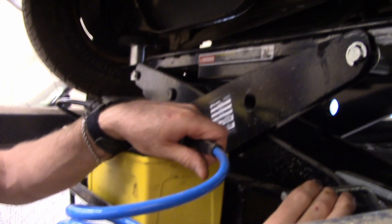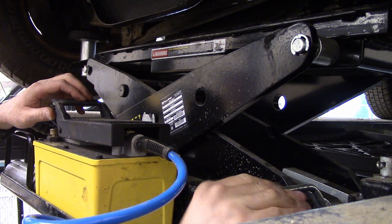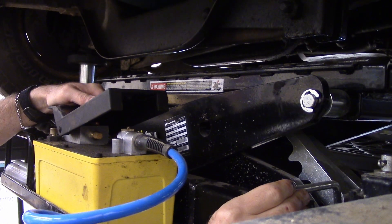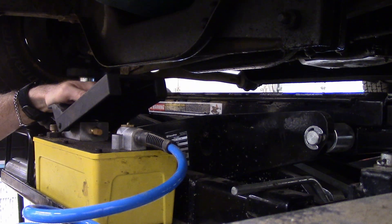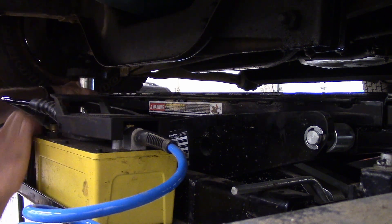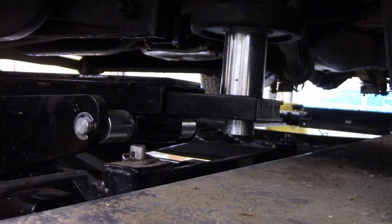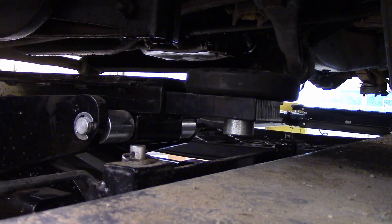When you're done, raise it off the locks. Manually lift the lock so it's disengaging, and then lower the vehicle. Then you can just let go of the locks and it'll go all the way down just fine. Then remove the extensions so they don't snag anything when you're driving away — it also saves the next person from having to readjust it. Do be mindful that your trolley jack is not lifting your vehicle up by the oil pan or something like that.